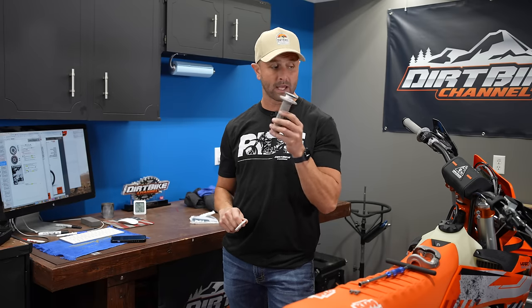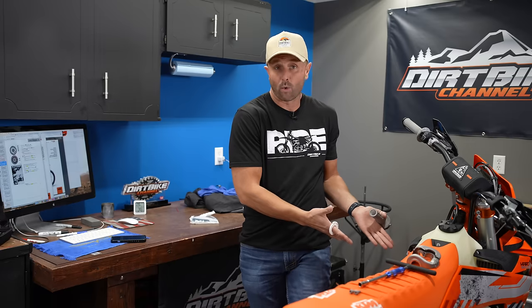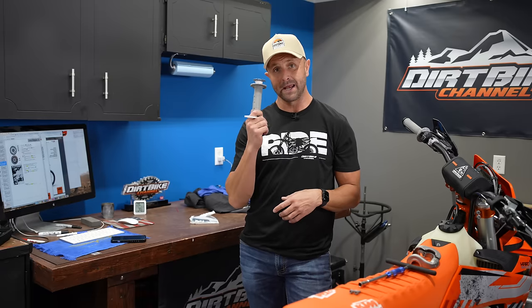Here's what I have done on a lot of my bikes. Typically — and it depends on the bike — I'll use the black cam on a 250 to make it a little bit more snappy on the bottom end. And then I'll use the gray cam, which is the stock cam, on the 300s. That's because I'm looking for a little bit more mellow power delivery on the 300s. I'm typically doing more slow, tight technical stuff on the 300s and I don't want the power to come on quite as fast. They have more low-end anyway on the 300s than the 250s. So usually I'm using the gray stock cam on the 300s and the hotter, more aggressive black cam on the 250s.